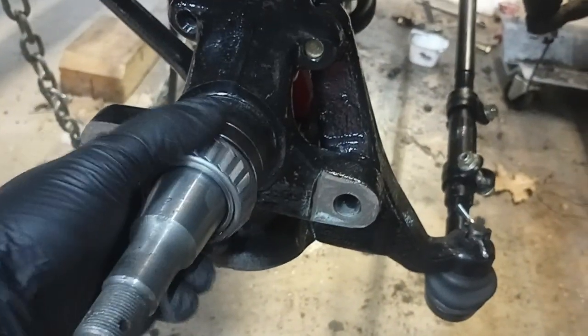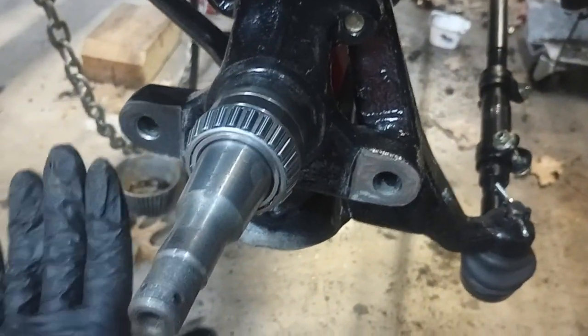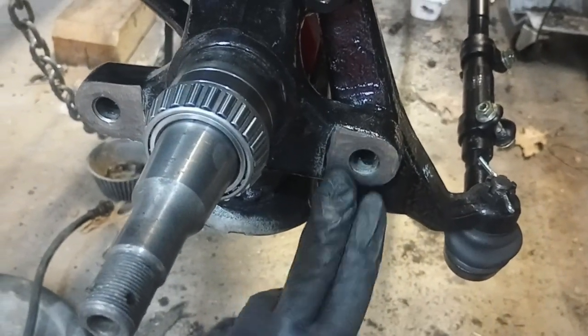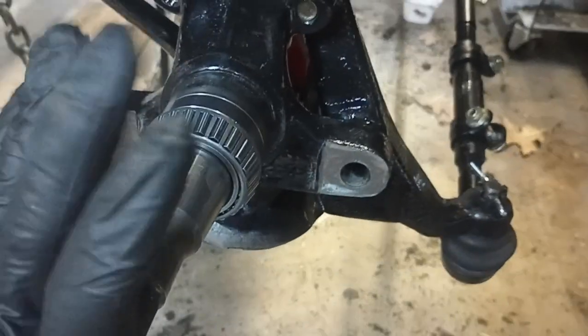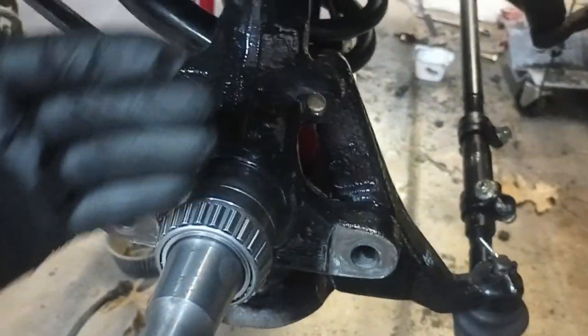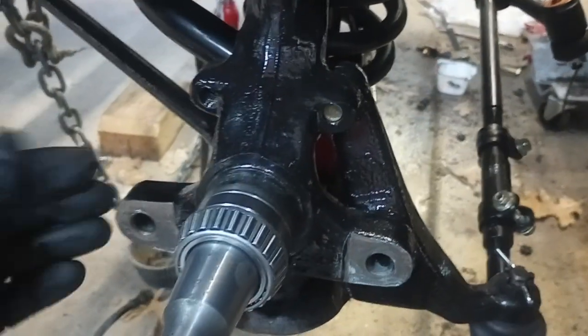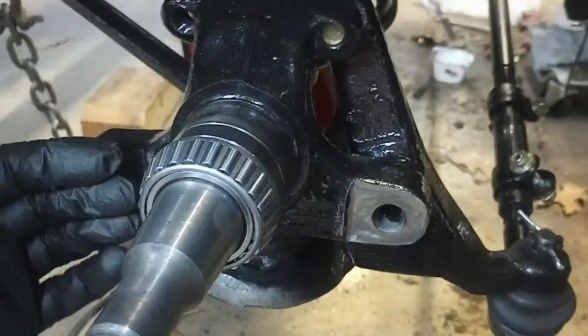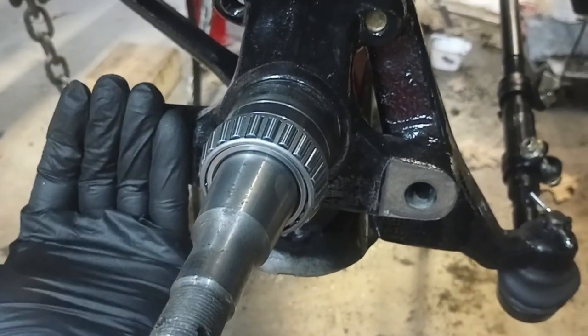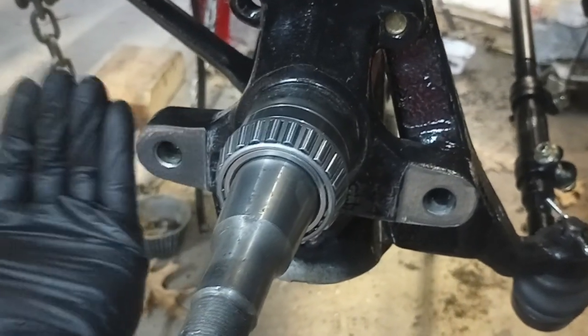I've had these on and off about 20 times. Turns out there are some variations in the mounting surfaces, because when I put the bracket on and installed the brake, the rotor was actually hitting the bracket. The other side was even worse. The clearances were all off, and because they sit on the front, you can't shim anything — if you shim it, it comes out, and we want it to go back, not out.